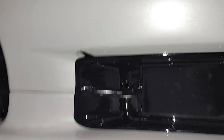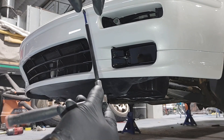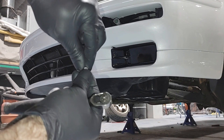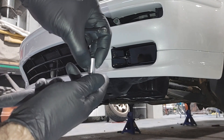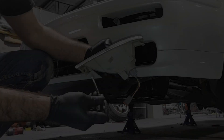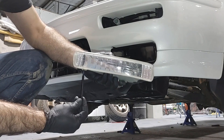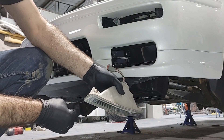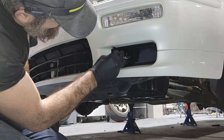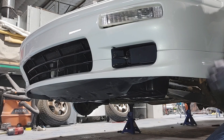They left a hole and that's all we need to access the screw that holds the turn signal lamp in. The screw we're looking for through that hole is a standard number two Phillips. I use a tool that looks like a six inch long screwdriver bit with a small adapter to adapt it to a quarter inch ratchet — it gives me good access and plenty of length to get up to that screw. You'll see there's a white nylon plastic guide that will kind of help you get the screwdriver in the right spot, but sometimes it can still be tricky. I would try to just hold the six inch bit with your fingers so that you can feel when you are actually getting into the grooves of the Phillips head screw.